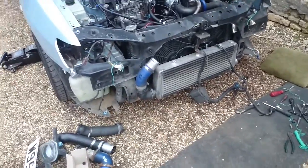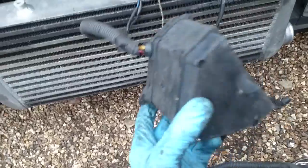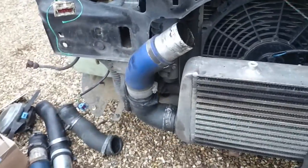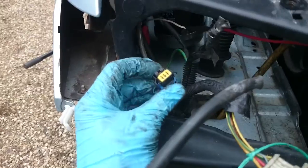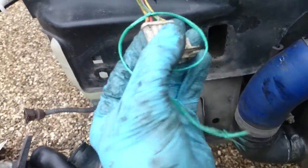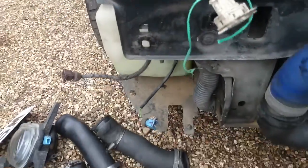It's pretty much a lot of the same really. I'm digging out looms, I'm removing unnecessary bits, a bunch of relays that work single and slow speed. Well, I just want a switch that'll just turn it on fast basically. Simple enough. Loads of loom here that I won't need, extra parts for air conditioning, for headlight adjusters, etc. So I'm using a piece of string, and every plug that I want to keep, string around it. If a plug hasn't got a string, it'll get stripped back and removed.